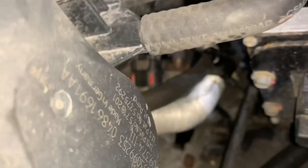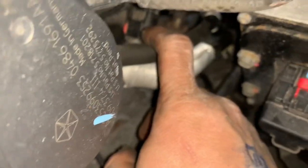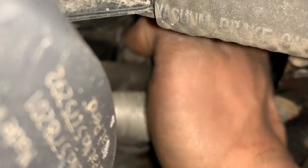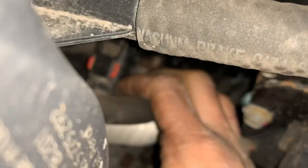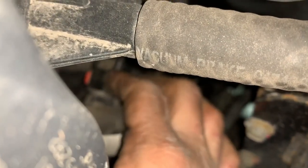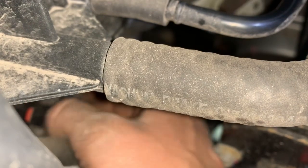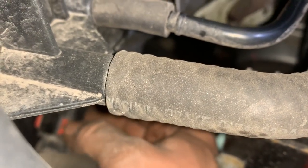Now with the EGR bolts all out of it, we can take and slide over this red clip, and then we will be able to push down on the black button once that's slid over — we only have to click it over, you don't necessarily have to pull it out. It's kind of hard to do with one hand. Sometimes these are a little bit sticky, so you can take a screwdriver and push them a little bit. Now, to make removal easier, we're going to see two little clips right there and remove them with some pliers to make the removal easier. You could probably fish it out of there if you tried, but I'm going to do it because I know it'll be right and simple.